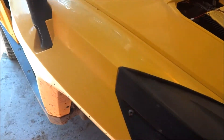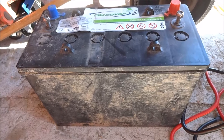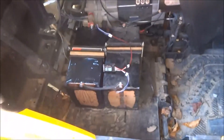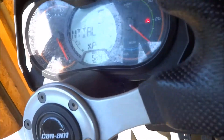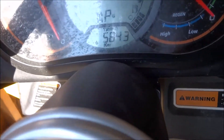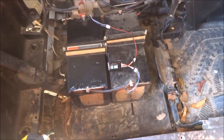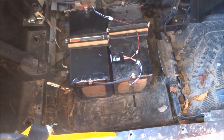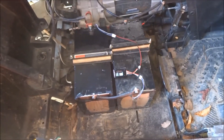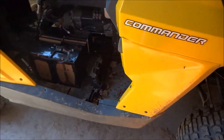I did use it a little over the winter by reinstalling one of the old lead acid batteries that came in the Commander — they had eight of those — in place of the dead battery, just to be able to use it a bit. I'm at 58,584.3 miles. With the lead acid battery it wasn't very good, and lithium-ion batteries don't work very well in the cold, especially ones designed for laptops — the voltage would drop pretty quickly on acceleration. So not ideal for a winter vehicle, but I don't use it much during winter anyway, so that's fine. It works great in the summer.